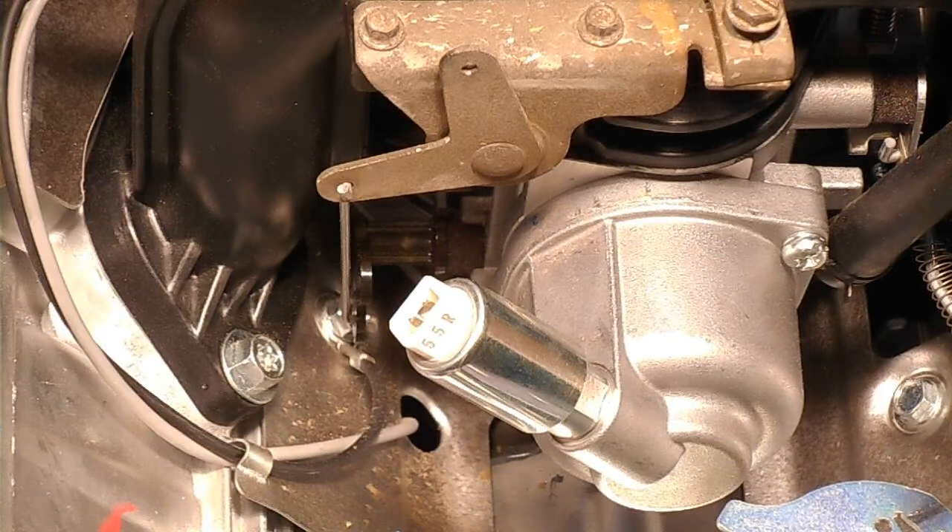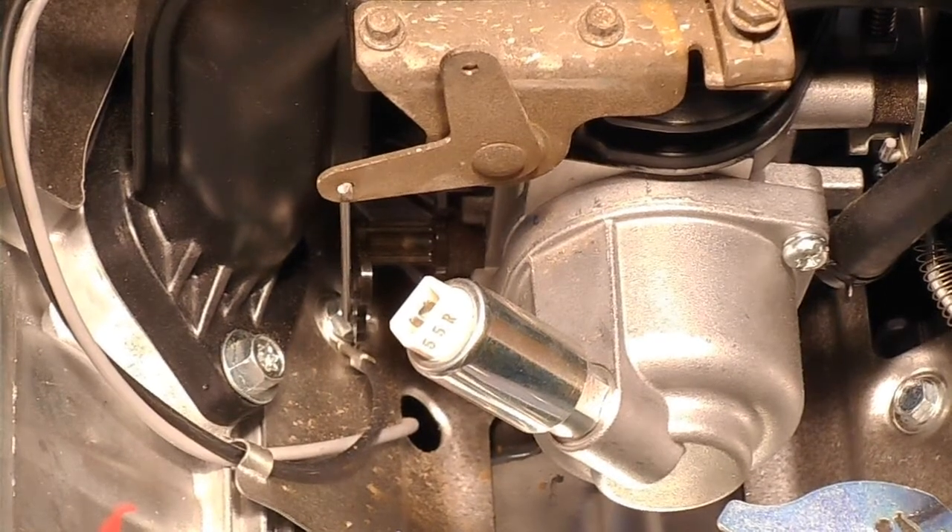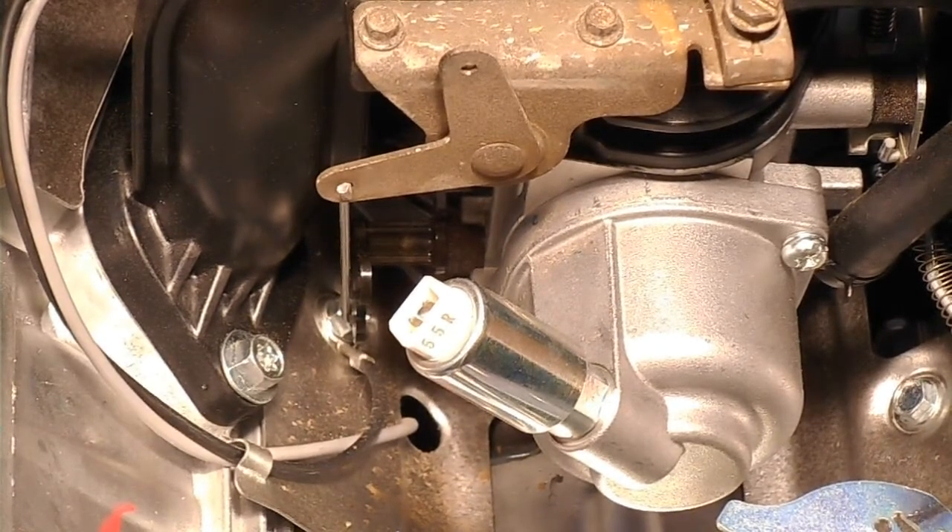What they did was they connected the throttle linkage to the choke linkage, and the only way to engage the choke was to set the throttle wide open — actually past the wide open point — so when the engine cranked, when you backed off a little bit on the throttle, you were at wide open.